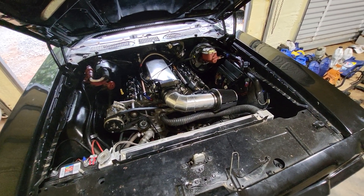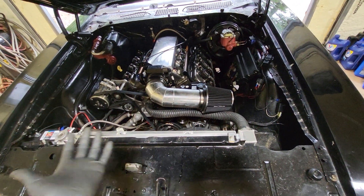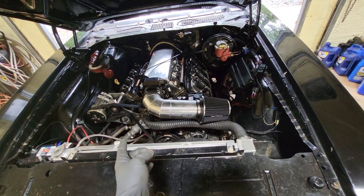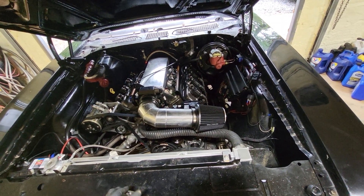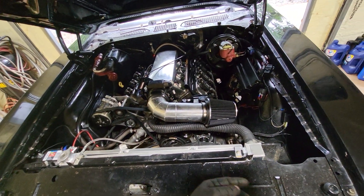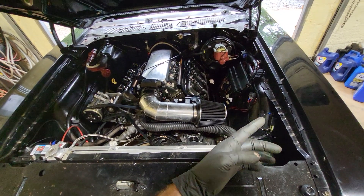There are the Holley relays. I ran this relay because I couldn't find a wire in this car anywhere that kept power in both run and start. I tried it initially pulling from the starter wire so the starter wire would trigger it and back-feed the wire on the Holley to maintain power in the start position, but it was back-feeding through the relay. So I ordered a diode off Amazon and put it on the output side of the relay going into the Holley, which only allows current to go one way.